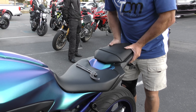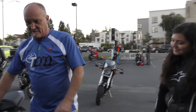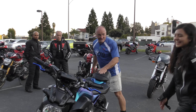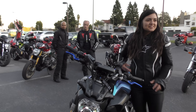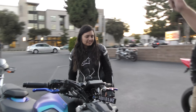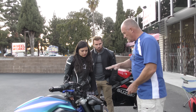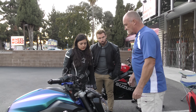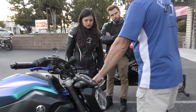Now I can pick it up, so you're safe. The other part about having a spring smash flat is you're going to ballerina, and there's no reason for you to ballerina — that's a choice, not something a motorcycle should give you. The forks are way too high for what we need, and because they're really high they've got no grip. So lowering these through 10 millimeters is going to make a big difference for you.